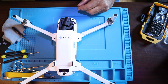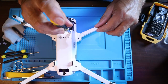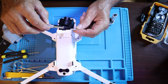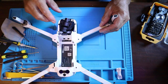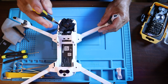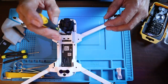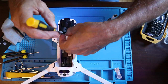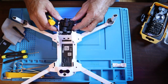Let's get to it. I'll take off this little cover here — pretty straightforward. We're going to take this little cover off first and it requires two screws. Little tiny screws, so it's nice to use the magnetic tip screwdriver. It's a triple-zero Phillips screwdriver I'm using. The next thing we've got to take off is the gimbal — it takes four screws, two on the bottom and two on the top. They're machined little screws, so we'll keep those separate. It's always nice to have one of these blue pads — I'll put the link in the description.